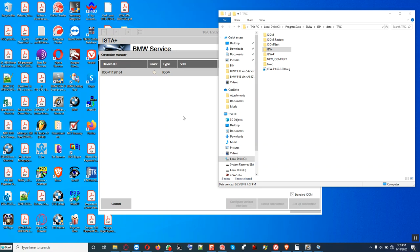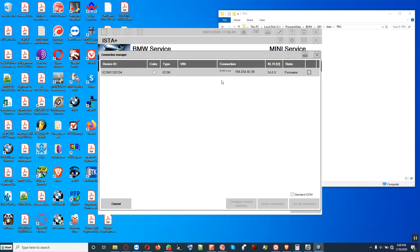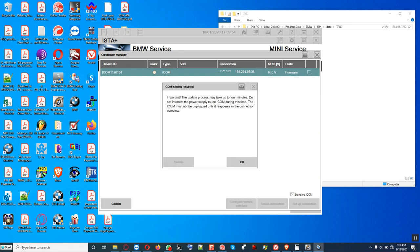Okay, YouTubers, we're gonna work on a BMW G30 today. This is a firmware problem here. There's a way to update this thing. Configure vehicle interface, just click here. It's important, the update process may take up to 4 minutes. Do not interrupt the ICOM during this time.